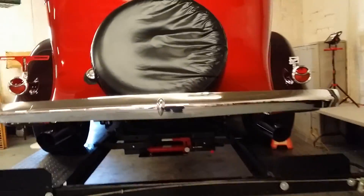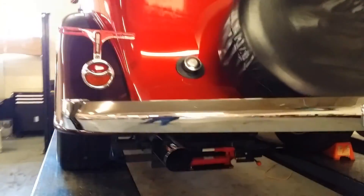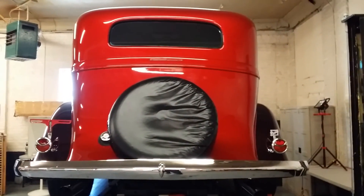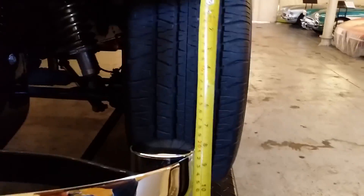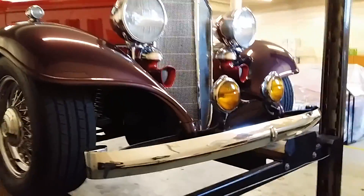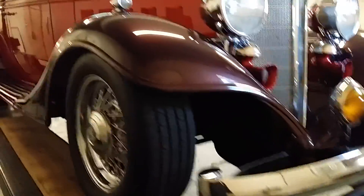Stopping the car halfway down, we'll take a peek at it here on the hoist. The rear bumper alignment is nice — if I keep the camera level you can see the bottom edge of the fender lip and the car's got a nice, square, straight look from the back. Taking a rough measurement off the edge of the bumper — I'm at just a skosh over nine inches on one side and about nine inches on the other, so it's very close. Somebody's done a real nice job assembling this car.